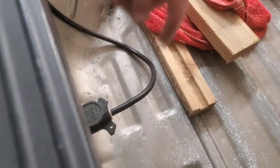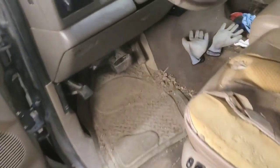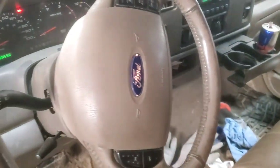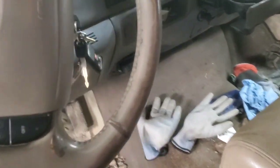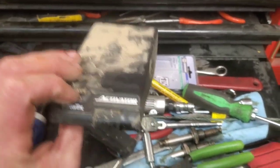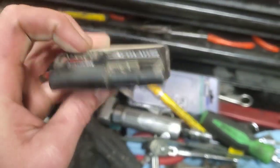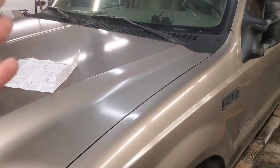If something doesn't work, then it's the trailer itself. This customer told me the trailer brake controller would lock the brakes up completely every time he hit the brakes, no matter how low he had it set. That's pretty much a sign that everything is working electrically but the controller itself just burned out. It was an older one — they just don't last forever. Looking at the old one, you can see the adjustment was all the way to the right — set to lock up every single time. Can't have that.